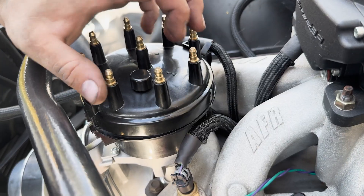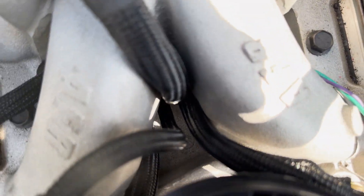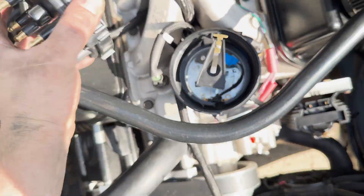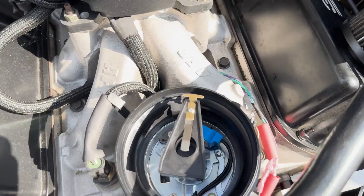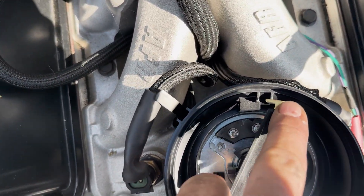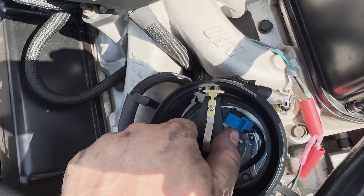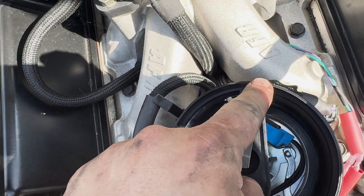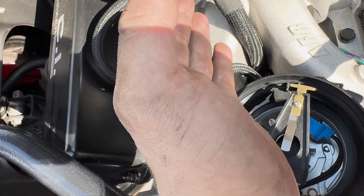With the distributor in and snug, I'm working on rotor phasing. This white mark marks the number one terminal, and with this two-piece distributor cap, at 45 degrees before top dead center it's pointing pretty much directly at the number one terminal. I want to confess I made a couple of mistakes: the rotor phasing worked but wasn't perfect, so I ended up redoing it later. Also, I wasn't aware a DuraSpark distributor actually has mechanical weights in it — there are weights buried beneath the base plate. I'm going to show you how we welded those plates to lock out the timing curve, and how I bent the tab on the vacuum advance to dial in my reference angle exactly.